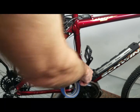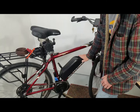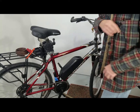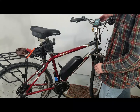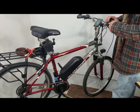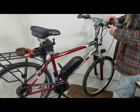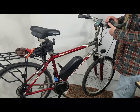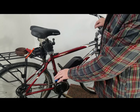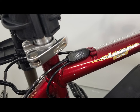Let's test it out. Battery on, switch on, power on — relocating the microphone so you can hear me along with the bike. Applying some power... now shifting. You might have been able to hear it — it cut the power briefly to the motor, allowed the derailleur to engage to the next gear, then turned back on and applied power. That is a gear shift sensor. Subscribe!